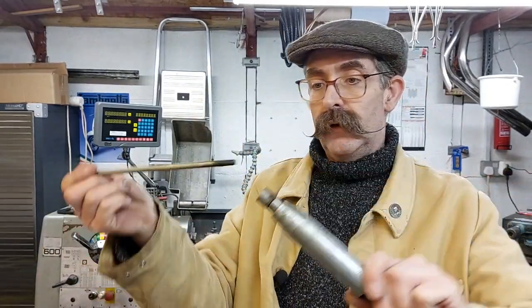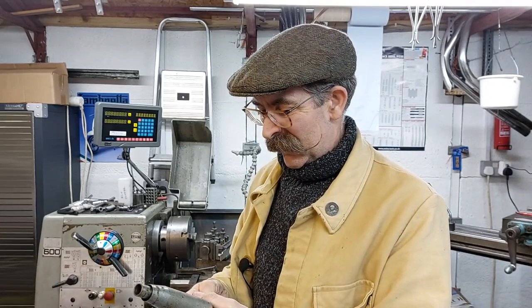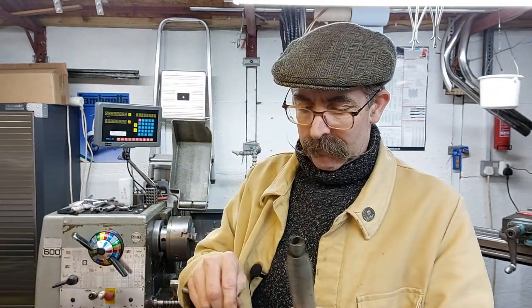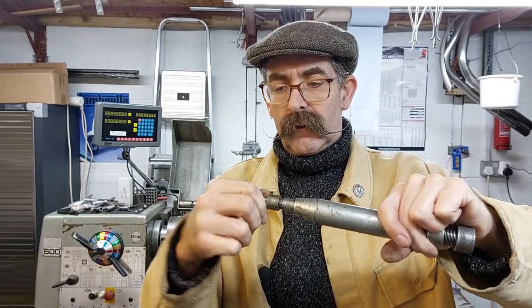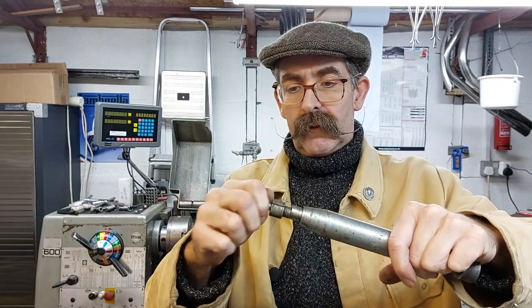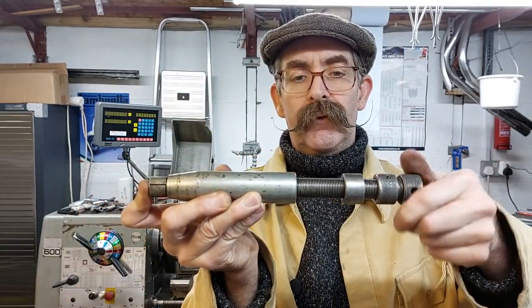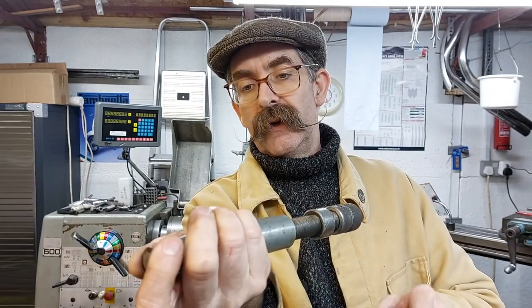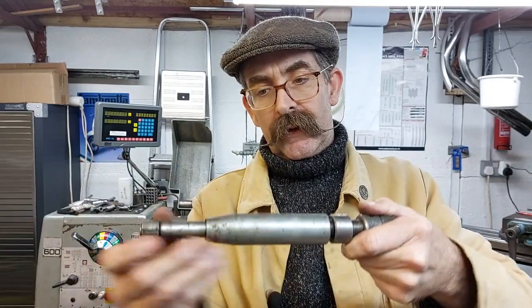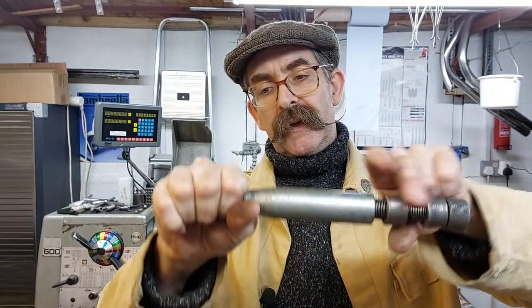put your corresponding collet on, and that's got a taper at the end to tighten it up. Try and find one that will go on nicely. No, let's try another one. There we go. Yeah, so that goes in there. Like that. And then put that end in like that, tighten it up. And then this draws this taper down through this and spreads that out to tighten up into the end of your flywheel. And then you put your clutch on and then tighten this down so this taper beds down into your clutch plate and lines it up.